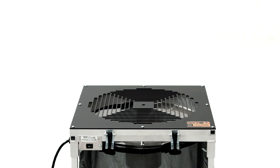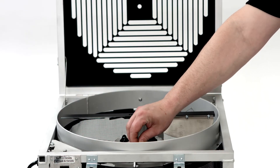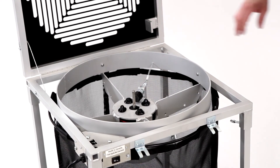Now that we have seen how to adjust the height of the blade, we will see how to remove it for sharpening. Apply the steps for screws A and B. Once screw B is loosened, the blade can be lifted off. If you do not touch screw C, you will have the same height adjustment when reinstalling the assembly. The blade should never be separated from its hub.